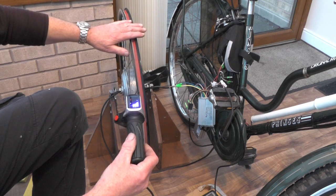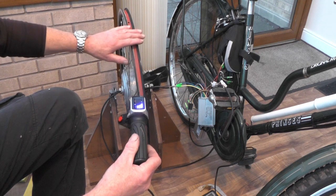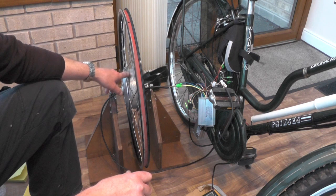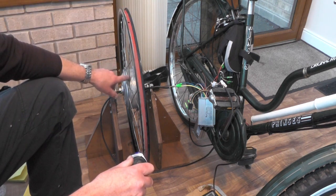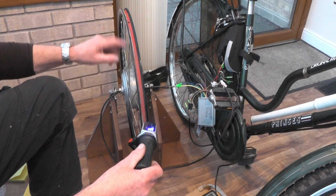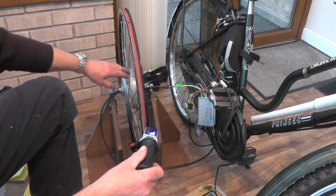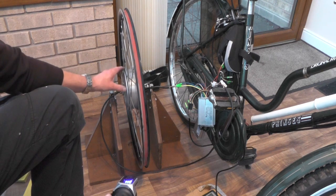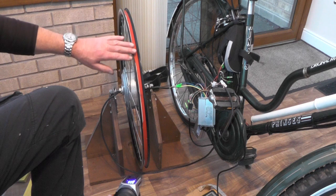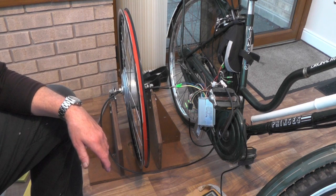I think that's going a bit faster than it should be, because this is a 24-volt motor and I've got 36 volts running into it. That will push the wattage up — instead of being perhaps a 200-watt motor, with this 36-volt battery it'll probably end up being a 400–500-watt motor. The downside is: A, will my controller take it? I think it will. And B, the motor might run a little hotter than it would on 24 volts. I'll keep an eye on whether it heats up, and if it does I'll probably have to revert to 24 volts.